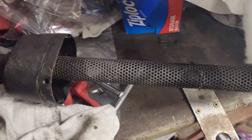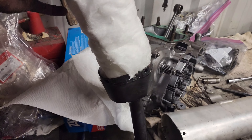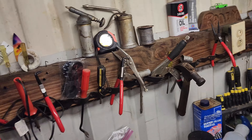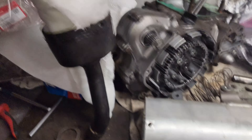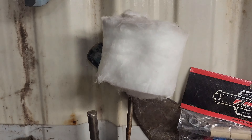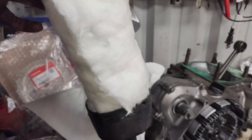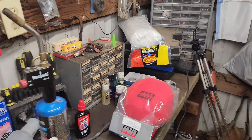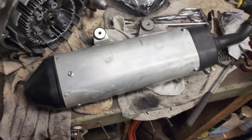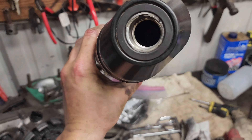Let's go ahead and get this wrapped around here, cut to length, and then we'll cram it all back together. I don't have any masking tape — it all stuck together and I threw it away — so I'm just gonna go straight into the canister and get everything lined up. That's the whole roll minus a bit that was too long and would have stuck past the end of the pipe, so I trimmed it. The rest is a whole pack of packing, so we'll get it crammed together.